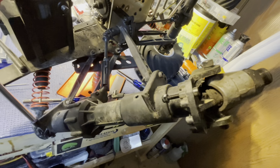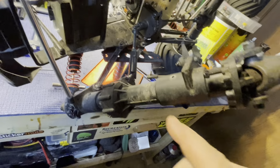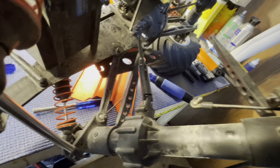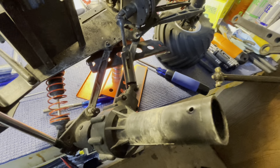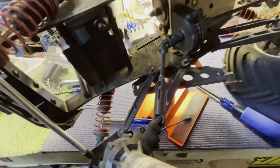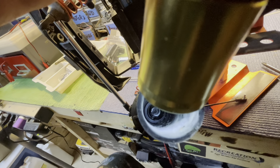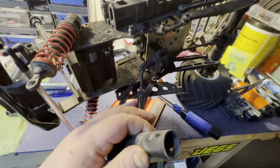To get the C-hub and axle mounts — the trailing arm mounts — off the axle, there's a screw here and one on the bottom side. Take those out and the whole thing just slides off the end, pulling the drive shaft out as well. Good to see there's some grease on there; I'll probably add a little more before putting it back in. Inside there you can see the inner drive cup that's connected to the differential. Now I'll get the new part out and show you how it goes on.